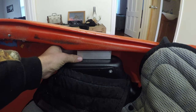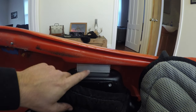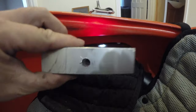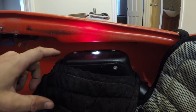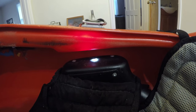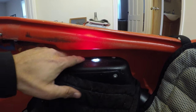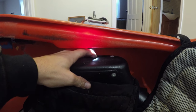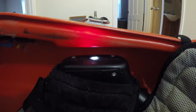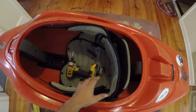I've cut two of these one-inch tube sections. With it centered and in place, I'm going to mark from the top with a sharpie where the hole is going to go, then punch through. With the hole drilled out, I went up one size — the bolts are quarter-inch diameter by 20 thread count, so I jumped up to a 5/16" bit. Then using a flashlight up top, I align the receiver for that bolt inside the seat as centered under the light as I can get, then drop in my spacer and try to catch that bolt going straight down.